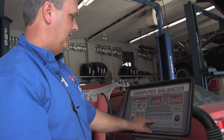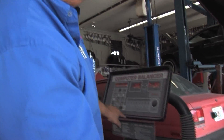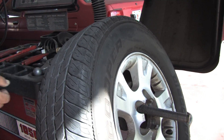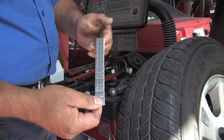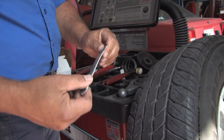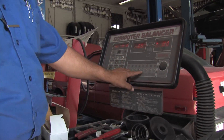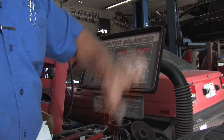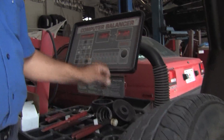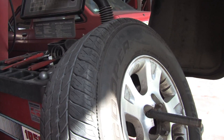This one has a different kind of wheel weights that stick on — for a rim that doesn't have a lip on it like this, you would have to use a stick-on weight like this one here. These are the stick-on weights for mag wheels. You can set your machine here for whichever type of tire you're balancing. Once you get all your settings in there, you close the lid, it spins the tire, and it will give you the amount of weight that you need to put on the inside and the outside. This has been Chuck Orlandi — thank you for watching.